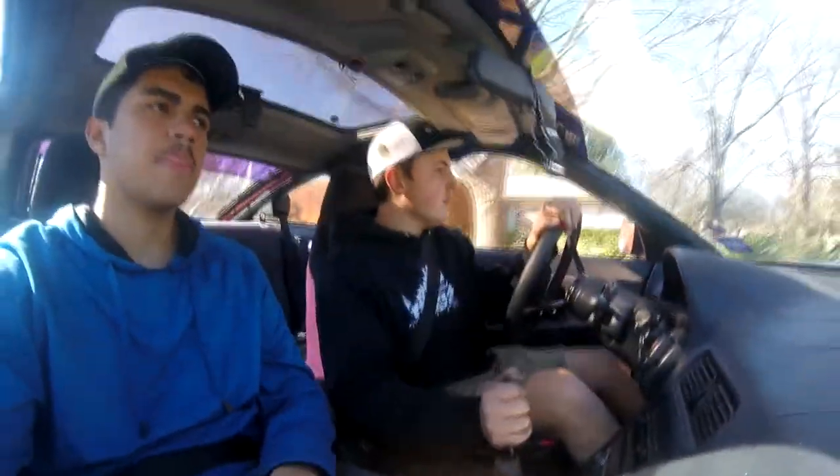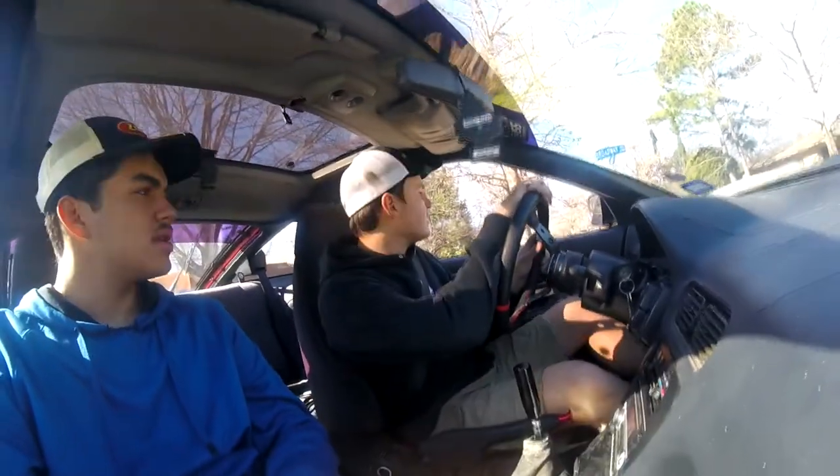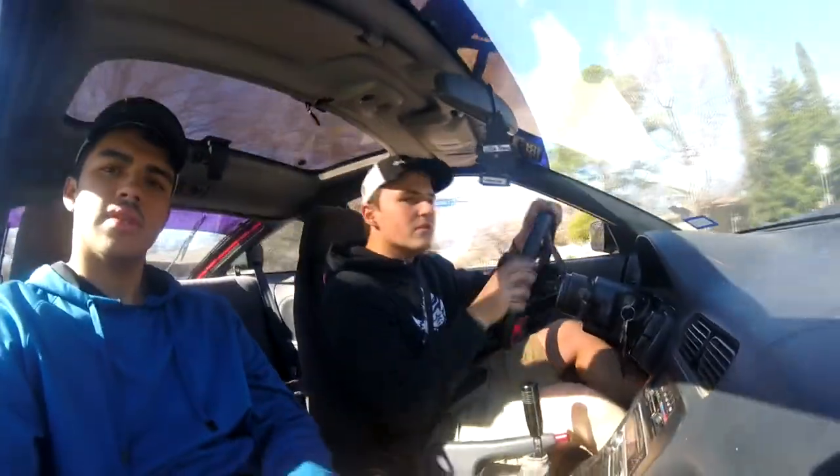I wonder, when I didn't have all the air in it, if it wasn't even engaging all the way. Sometimes it makes a huge clanking noise. So I'm just curious to see if it still makes a grinding noise, because it makes a grinding noise in third and fourth gear. So I'm hoping that fixes it. But I'm not gonna test it now. We're just making sure it's ready for the car show. We'll get back to you guys when we're gonna clean the car off.